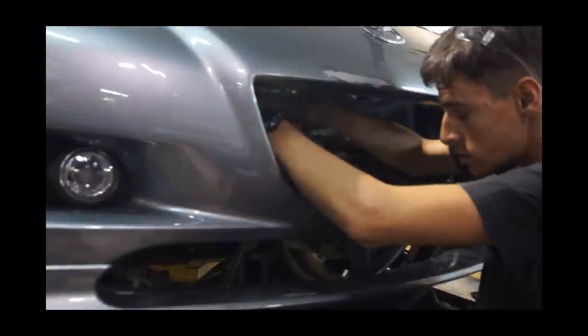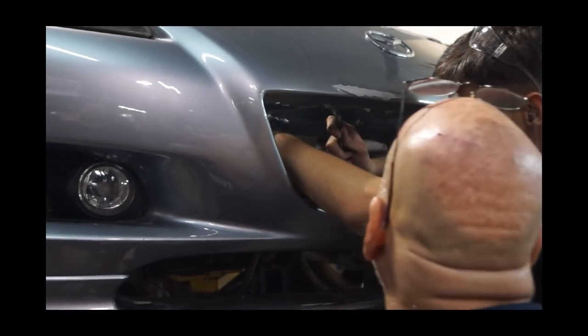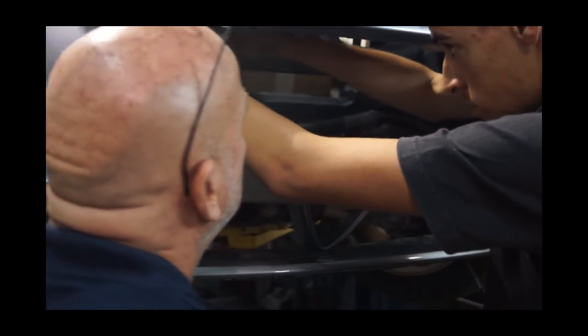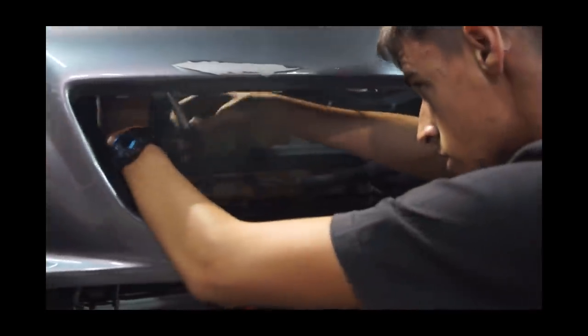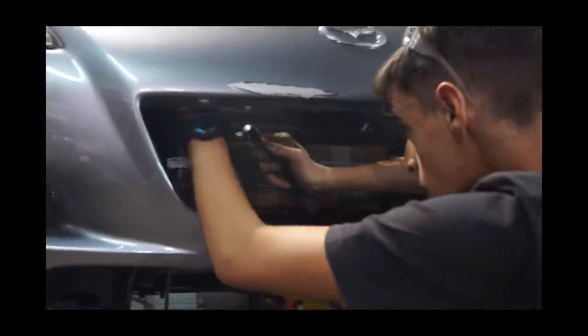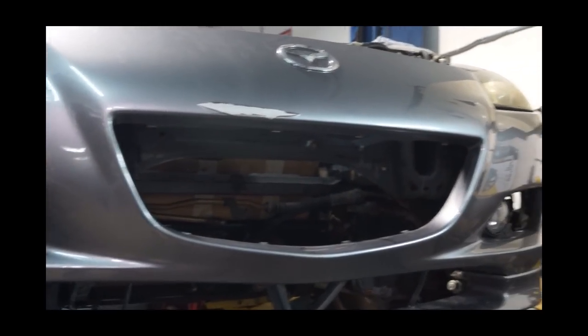It's just more work. If we could keep it in the same place, it'd be better. Well, regardless, if you leave the radiator and all that stuff here, the plumbing for the intercooler is going to be a challenge. Not that it can't be done, but what I'm mainly concerned about is having a really nice gooseneck going to the turbocharger with a proper air filter.